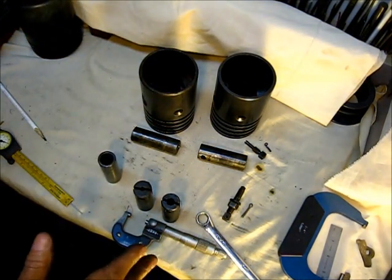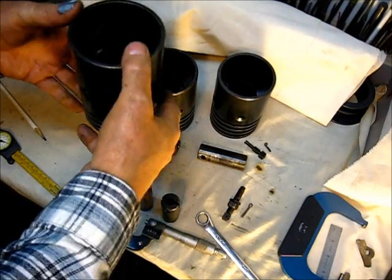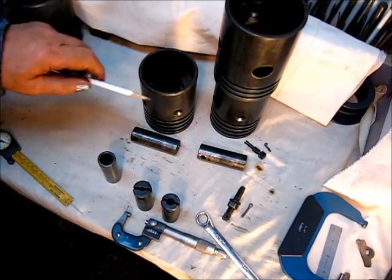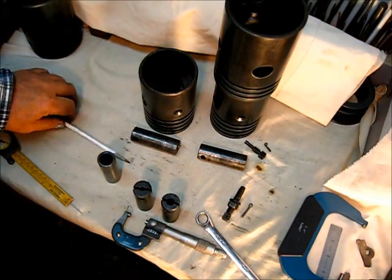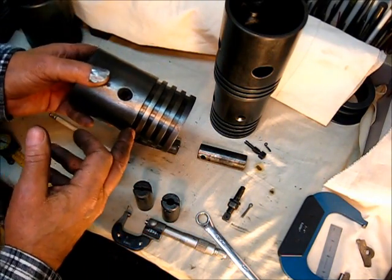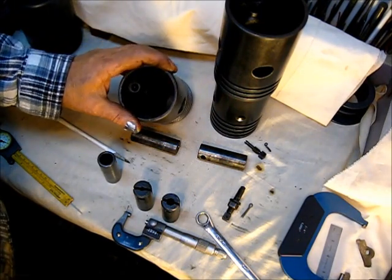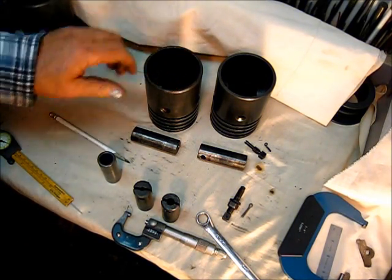You will find three different kinds of pistons. The other one being this spark plug model. The difference is this one is bigger and it only has three rings. All of the igniter models will have four rings, and there's just no valid reason to leave one of these rings off. There is no advantage to be gained in that. That's all I'm going to say about four rings compared to three.